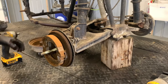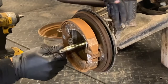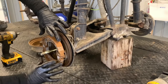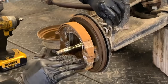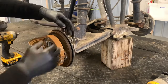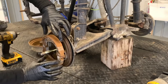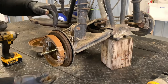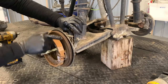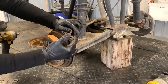Replace your brake shoes. Before pulling them off, here's how the mechanism works: when you engage the brakes, you're pushing this pivot arm back, spreading the brake pads apart and engaging the brake drum. Releasing the brakes puts the arm back to horizontal, compressing the shoes. If your butterfly nut is adjusted too tight, the shoes will constantly grind on the drum, wearing your pads down quickly and potentially melting the seal. Make sure the brake arm is adjusted correctly.